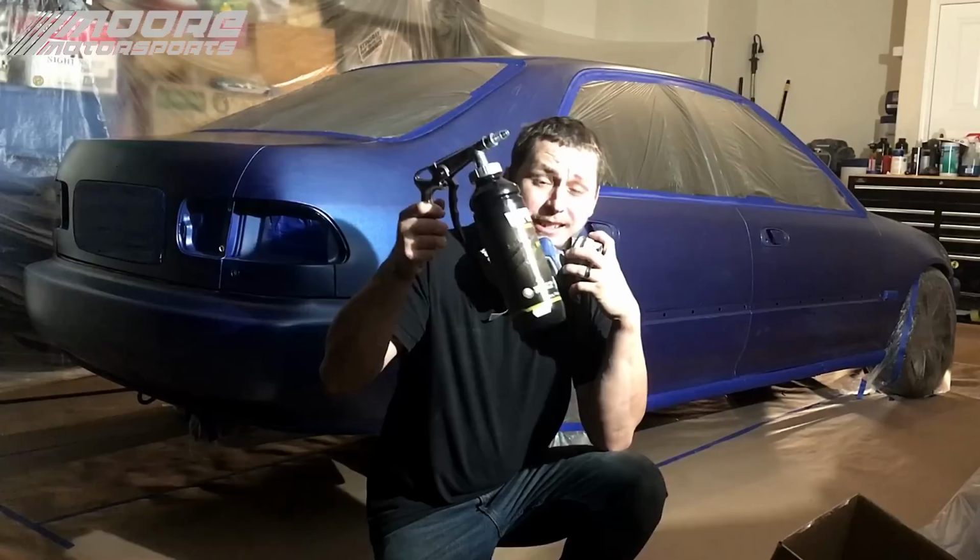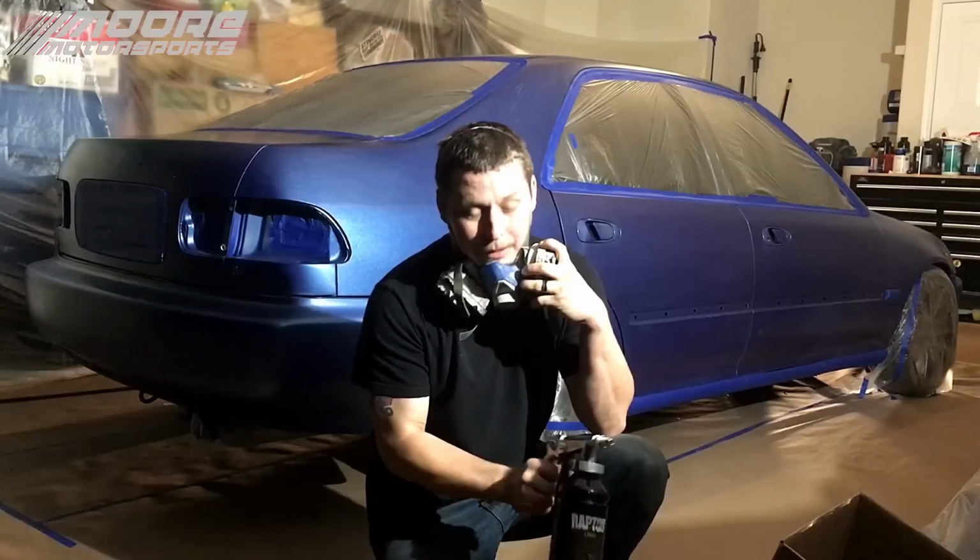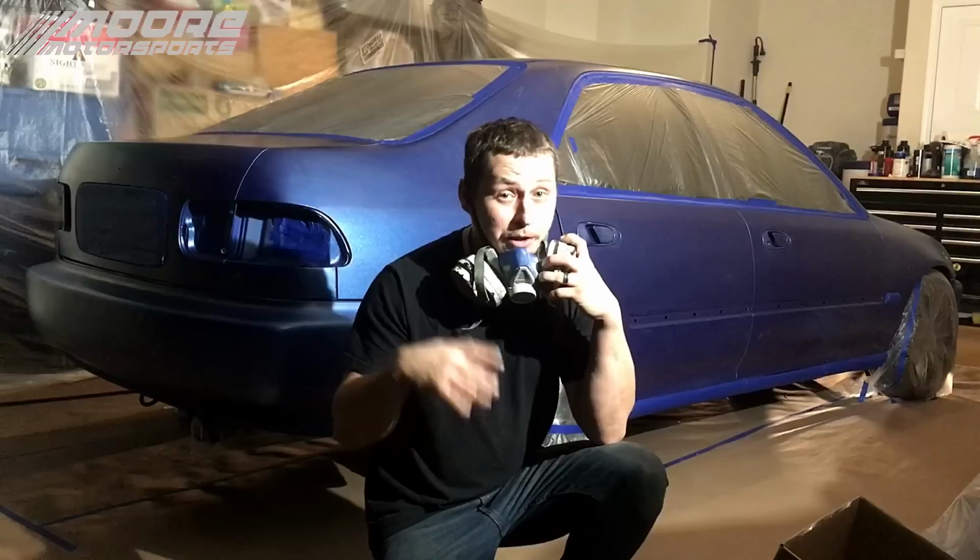Here we go. Okay, so we've got the Raptor gun. There will be a link in the description for this tintable kit. You can actually tint them with paint just from the local paint supply place, the single stage metal flake we have right here. Make sure to wear a respirator, make sure it's ventilated pretty decent, and you will want to have the compressor around 55 to 65.